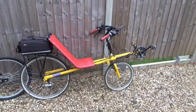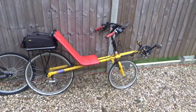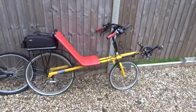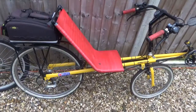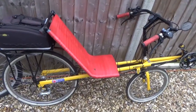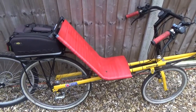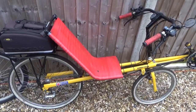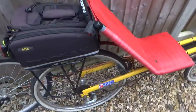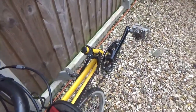Hello YouTube, it's me again. Today I'm going to be showing you how to build your own recumbent bike. I'm going to base it on my King Cycle. We're going to be using 40mm by 20mm steel box section, 1.5mm wall thickness, and we're going to be making a twin spar frame which is basically two lengths that go all the way to the bottom bracket.